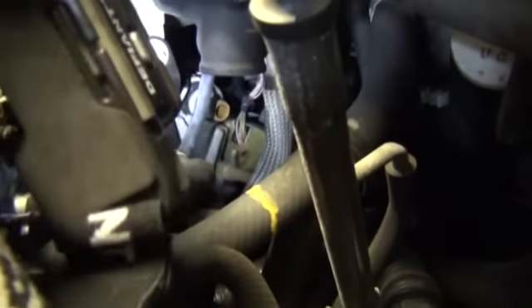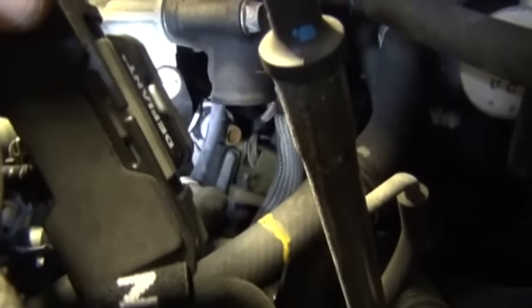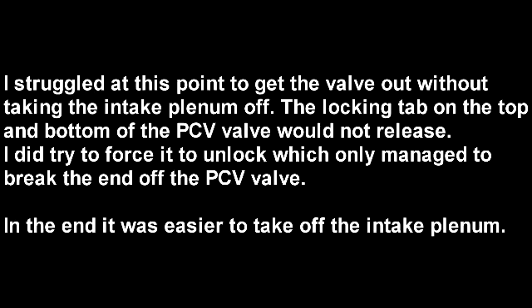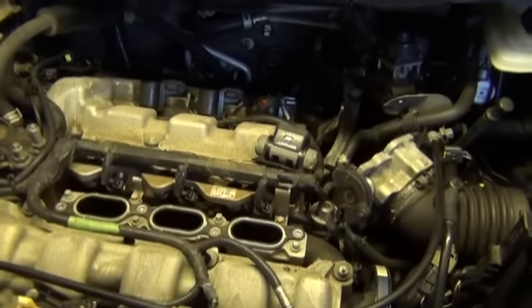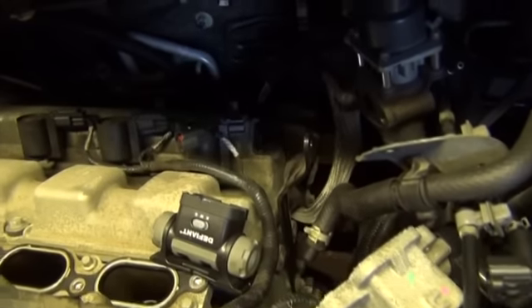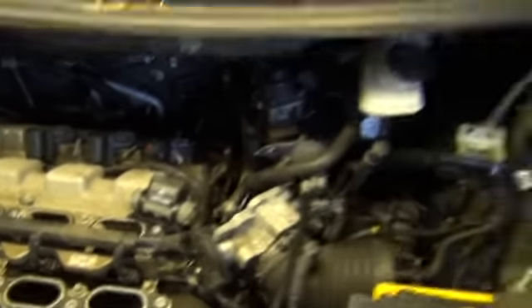That kind of orange color right there is the PCV valve that's inside the side of what I think is the top of the valve cover back here. Looks like it's got two tabs on it and then it unscrews. I did have to take the intake plenum off — the valve is located in the valve cover for the far bank. There it is right there, that's where it's supposed to go, and this was the only way I could get the clips free.